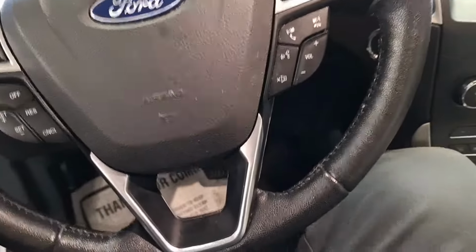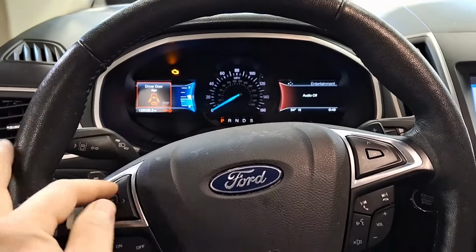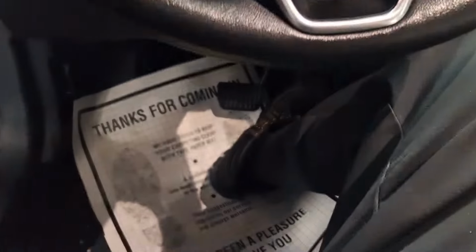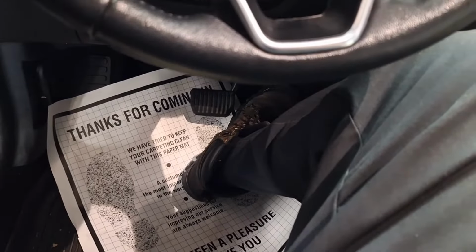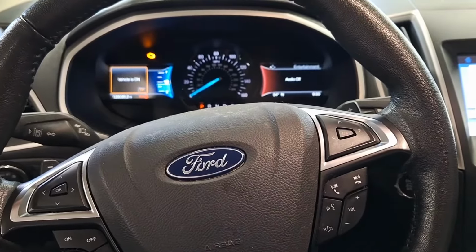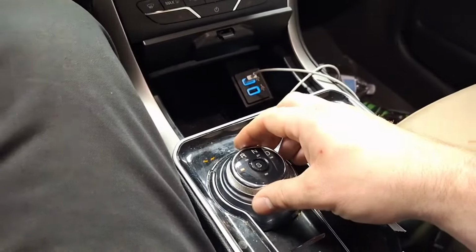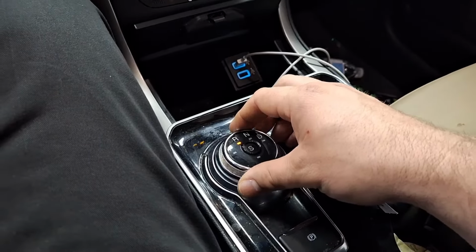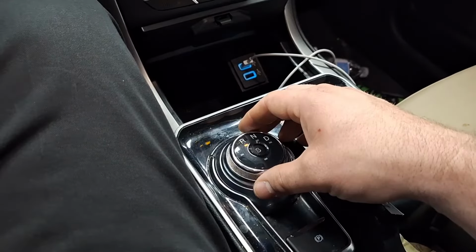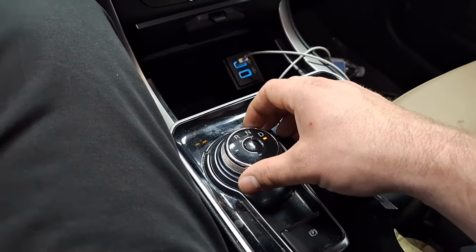Okay, I'm going to rev the engine. It's going to work the cleaner in really well. It's going to agitate deposits in the torque converter. Just hold the RPMs up here. Let it continue to mix the cleaner in. Just holding the RPMs up. It's good enough. Go reverse to drive. It's going to work solenoids for the direct clutch, forward clutch, and whatever other solenoids are used in reverse and drive on the 8F35.